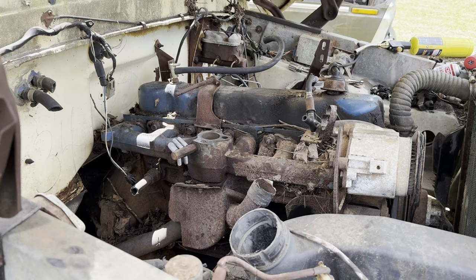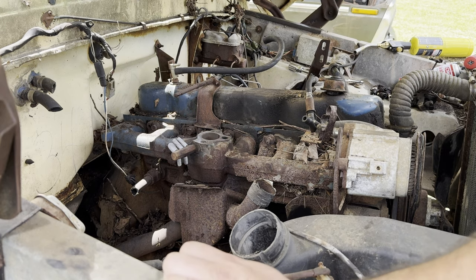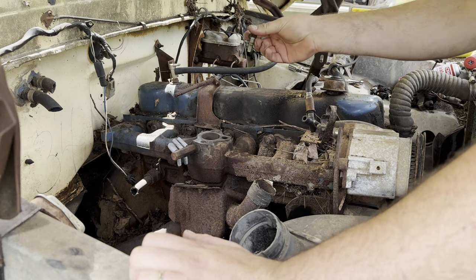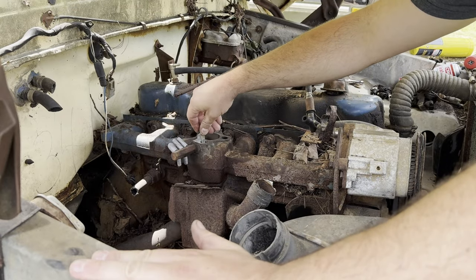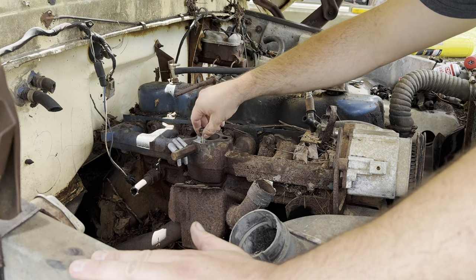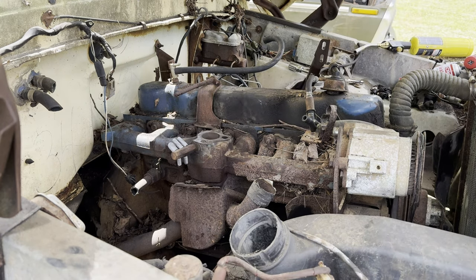So I went to my garage because these look familiar. Went up to a small block Chevrolet intake manifold I've got and pulled some bolts off of it. Aha! The hunch was right. So, small block Chevrolet intake manifold bolts will work for carb bolts on a 306, the more you know.